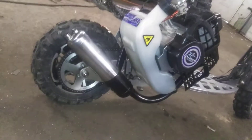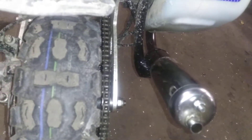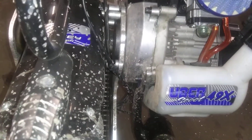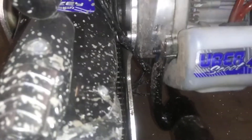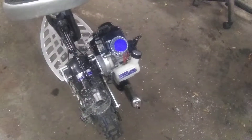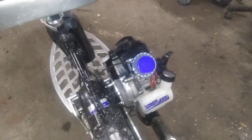I welded it all together, making sure to have it far enough from the gas tank so we won't have any problems — safety first. Down here I have a bracket attached, because I found out if you just leave it hanging, even though it felt solid, over time the weld broke off the exhaust flange up front. It gets very hot. I have it bolted to the motor right there. I know from doing cars, if you don't have a flex point somewhere it's just going to put a stress crack in it, so I put it to the motor instead of the frame — if the motor moves, it all moves in unison.